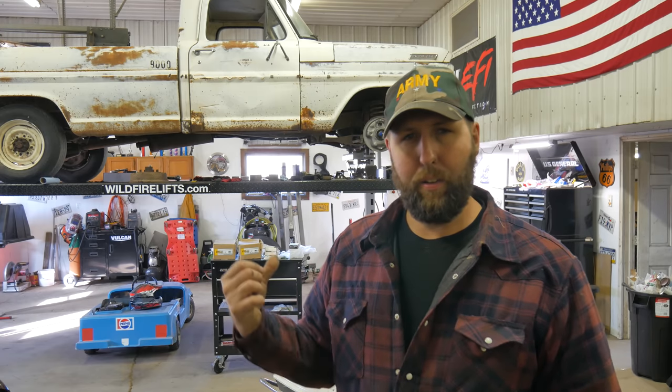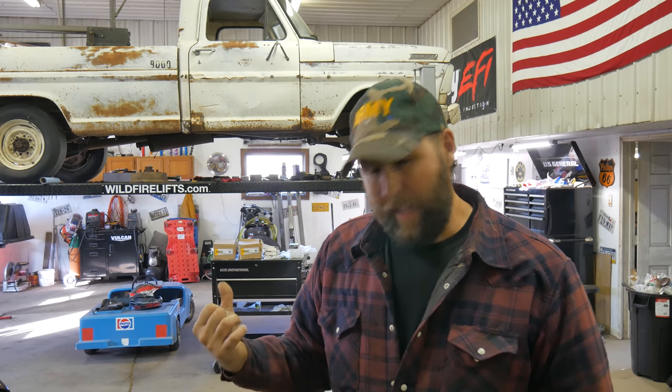I think we're going to start right on the fuel tank. There's a little bit of fuel in there and it smells really bad. Two-strokes are really particular with fuel and fuel mixture. Going back to the handwritten notes, it said 50 to 1 or 40 to 1 - but the manual, and right on the tank, says a 24-to-1 mixture is absolutely needed. My guess is they were fouling plugs and thought it was too much oil, ended up changing plugs in '91. I think they were chasing a problem and the issue was actually the plugs, not the fuel.